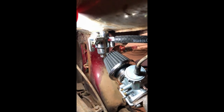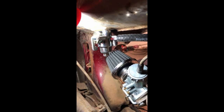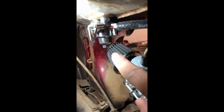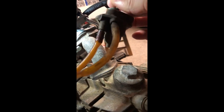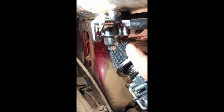Something else I noticed after I put everything on was that the new petcock from eBay doesn't have the port right here for equalizing both sides of the tank. This is the stock one — as you can see it has the port on it and you should set two tubes up to it. The new one has the spot for it but you'd have to drill the hole out and put a tap in there. So what I'm going to do is just connect it with a T on the upper side of the fuel filter instead.